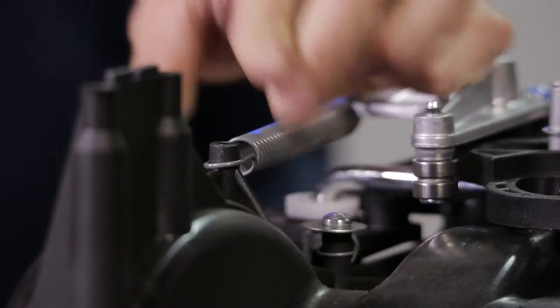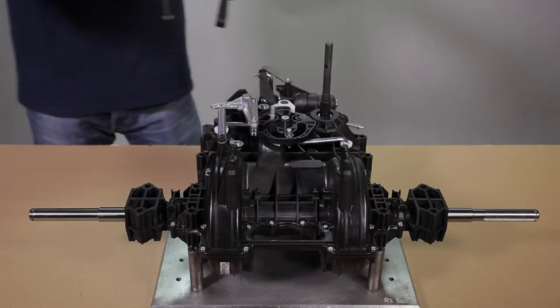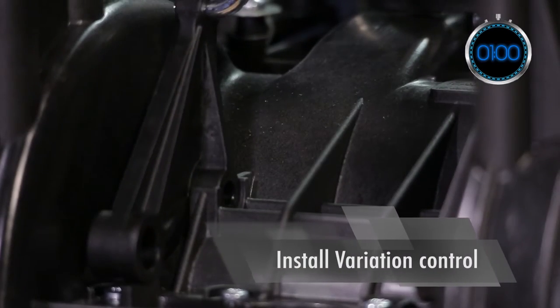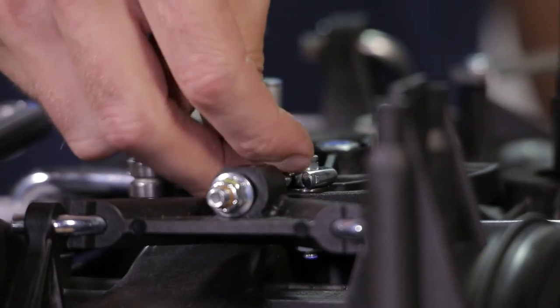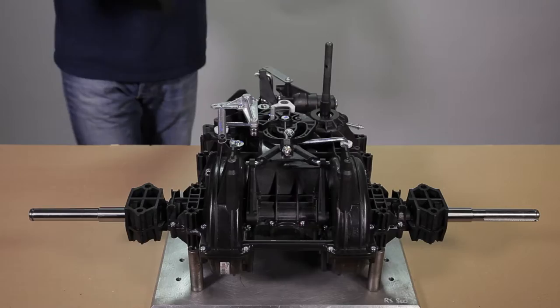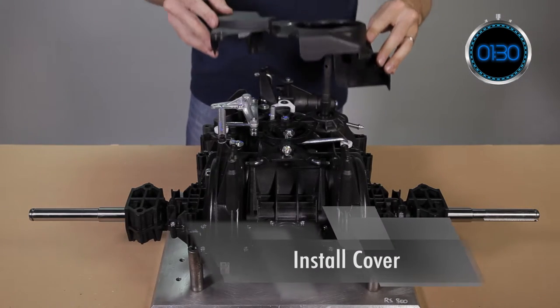Install the variation kit on the upper housing and connect the rod to its axle. Make sure the rod connects in the correct orientation before fastening the E-clip. Install the cover on the top of the transmission, then replace the four screws respecting the tightening torque.